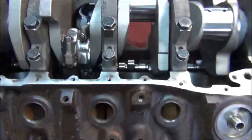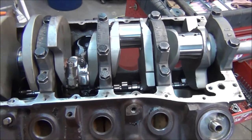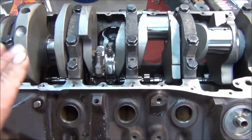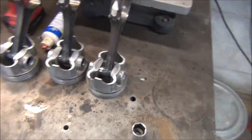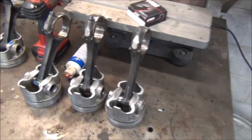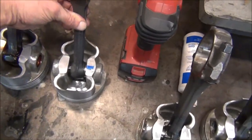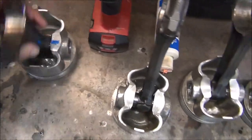I'm going to unbolt these after all that's done, bring that crank up and see if I can swing that rod. If it feels free in the position it's supposed to be in, I'll leave them in there. These are not free-floating wrist pins, which means they are pressed tight in the rod, but they're supposed to move freely within the piston.